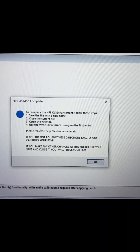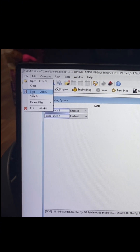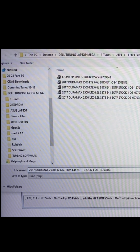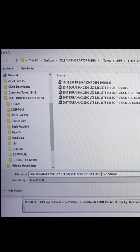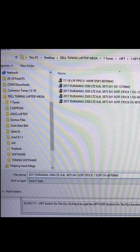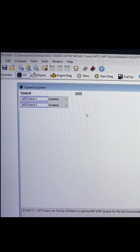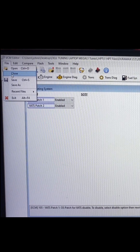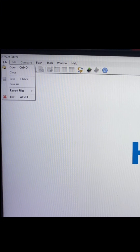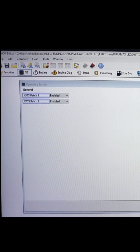It's not going to be shift-on-the-fly yet, so we're going to save that. Then we're going to come in here and hit apply modification. It's going to bring up these instructions — close that. We're going to hit file, save as. We're going to put 'shift on the fly' and also change the OS to 69, because when you apply that modification it changed the operating system to 69. We'll hit save and close this.